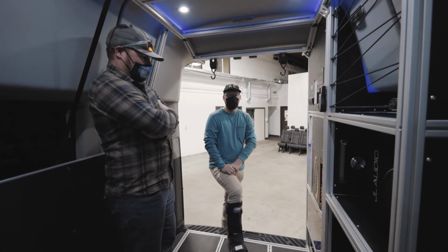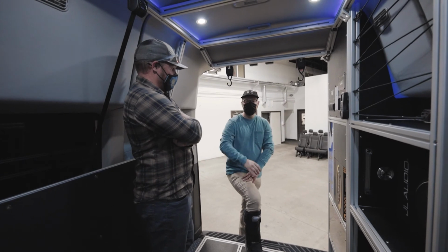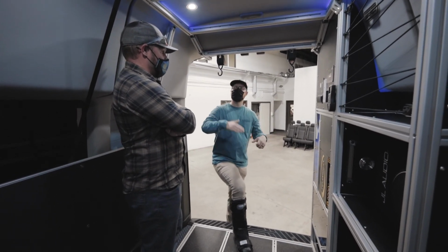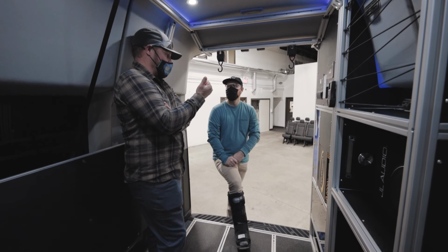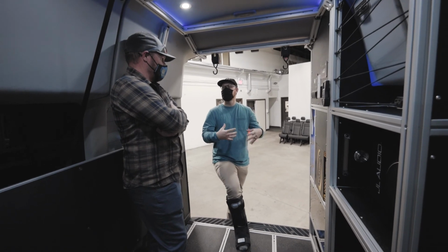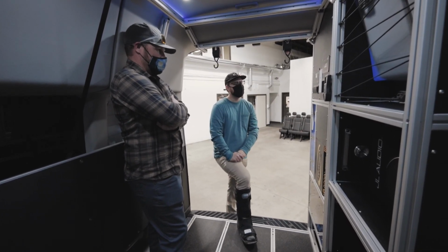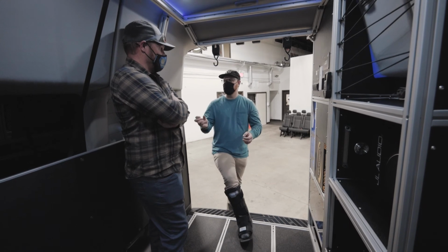Yeah. Higher drawing components like the hot water heater inside your water box up there is about 1400 watts. So if you left that on, it might show no pull when you leave, but when it heats up, it starts pulling that crazy amount, but then it kicks off. And that's basically a shore power only thing anyways. No, you can run it off power, I just wouldn't run it all day, constantly heating. I would turn it on when I need it and turn it off when I don't. If you had shore power, no issues there. But the water system still works inside of there without the hot water on. That's just optional, if you want hot water or not.